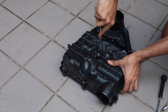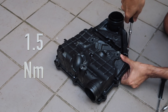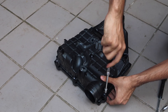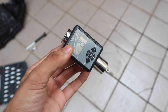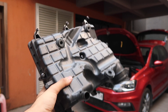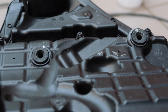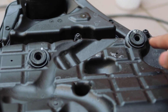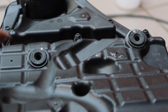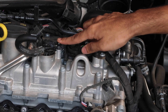We also tighten up the ninth T25 screw in the center of the housing. The torque spec for the T25 bolts is 1.5 Newton meters — just for fun I had a look at the least count of my digital torque wrench and it's 2 Newton meters. It's a plastic assembly, so you'd be good by merely hand tightening all of these T25 screws. Before attempting to refit the air box, inspect the three rubber mounting points and make sure all of them are in good shape, as these need to sit correctly on the mounting pins on the engine head.